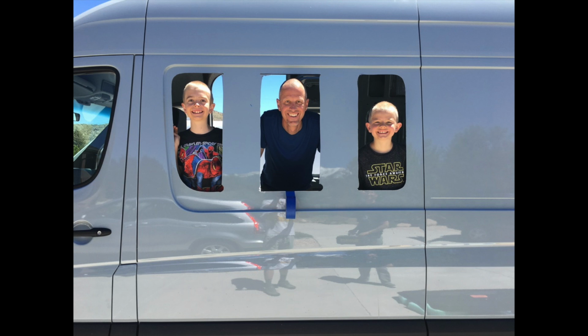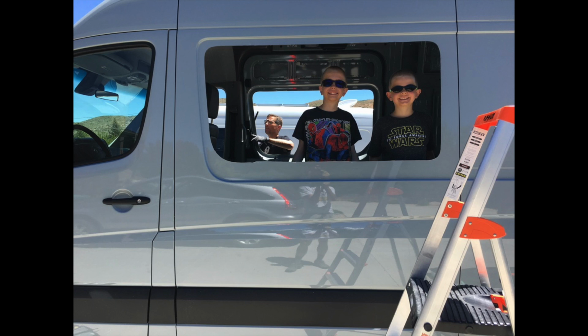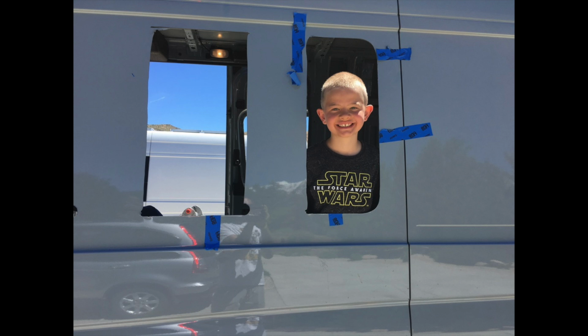When that moment comes to make that cut in the wall, make sure you have all of your tools handy, everything set up. As you can see here in some of these photos, fold and or grab the metal panel. Make sure people are wearing gloves. This is sharp metal you're dealing with. Make sure that your tools have really good blades on them that are appropriate for what you're cutting. Tape the area around what you're cutting with some painter's tape or other protective tape to prevent scratching from something like a jigsaw rubbing alongside it.